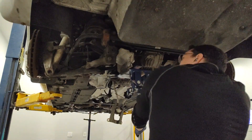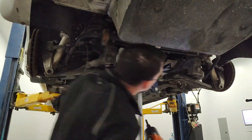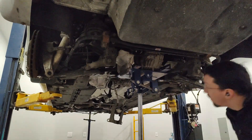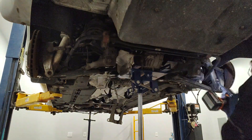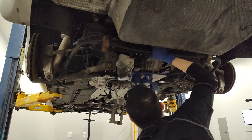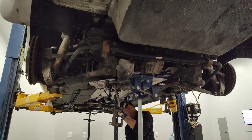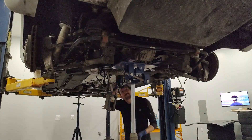You'll notice some things that seem like repeat motions. I'm dropping all of the screws out and then putting some of them back in a couple of threads, so I can drop the rear subframe down onto the bolts before actually removing it — that way it just doesn't fall. I have complete control at all points in time. It's just good practice so that if something lets loose, it doesn't fall four or five feet and land on you.